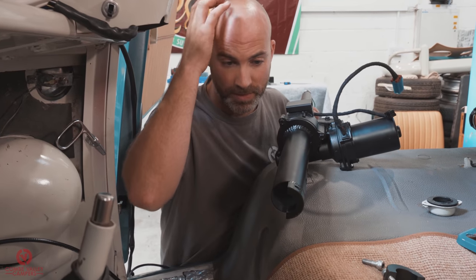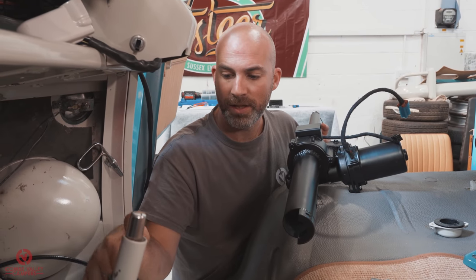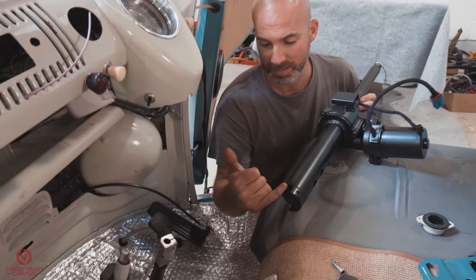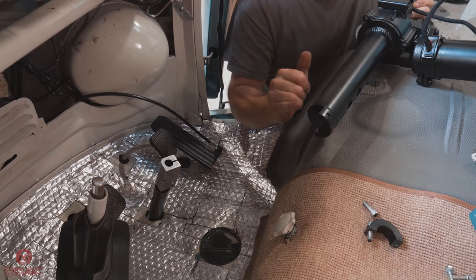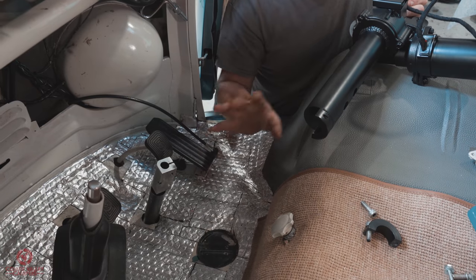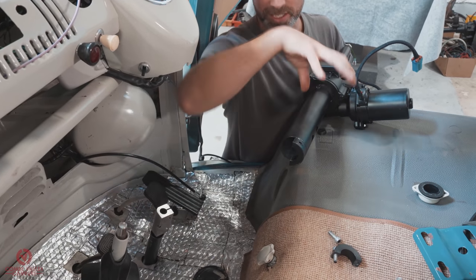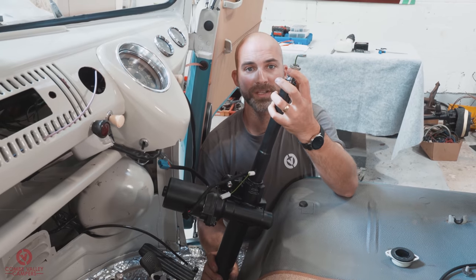And then we're ready. I'm taking this slowly because they're all points you're going to need to remember. There are three right-angled sides to this collar and one smooth side. This smooth side here is going to match up with this half of this shaft here. All right, so you're going to feed the smooth side of this collar over here and then feed the whole lot onto it. Before you locate the shaft inside there to the splined collar, turn the entire assembly round until that woodruff key is at 12 o'clock.